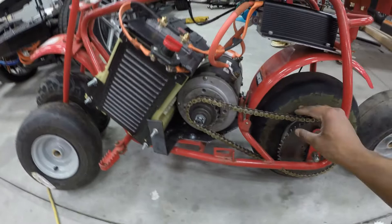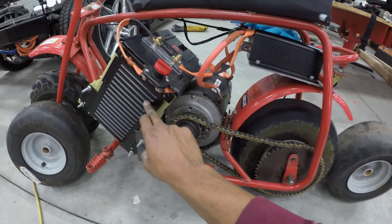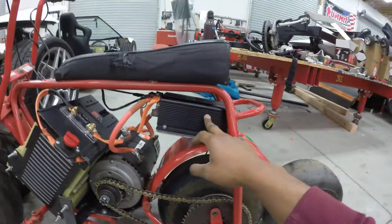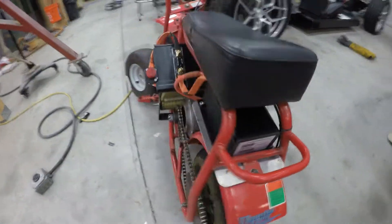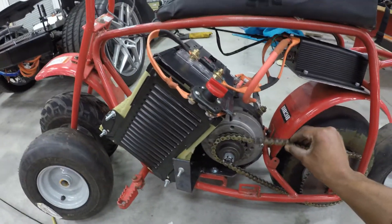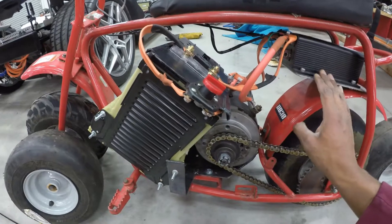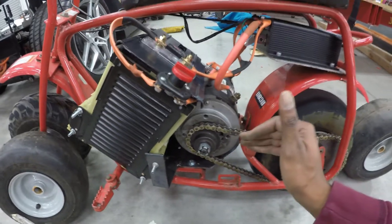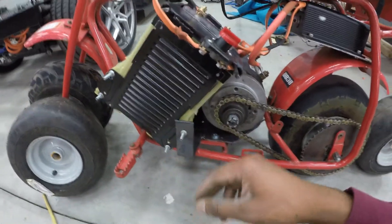Super, super cheap. I was able to do it for only about 200 bucks because I had a lot of these parts already. I had this motor — this right here was donated from XS Motor Works, go and like and subscribe his channel, I'll have his link in the description. This controller here is just an eBay Curtis style forklift controller — it's called a PMC DC motor controller, 48 volt. But if you want to try to do this on your own, it will cost you maybe around the $600-$700 range. The good thing about these components is they can be used in other projects. If this frame ever gives out, I can throw a lot more voltage at this motor, probably up to 90 plus volts. I'm thinking about expanding to a motorcycle frame because I have a lot more of these Chevy Volt batteries and I have room to grow.